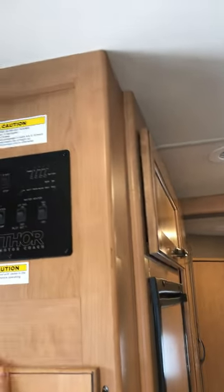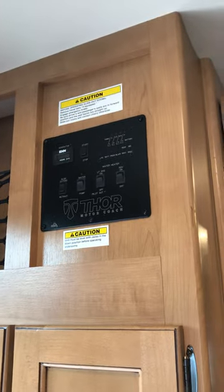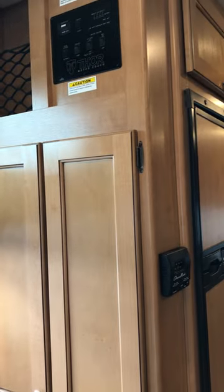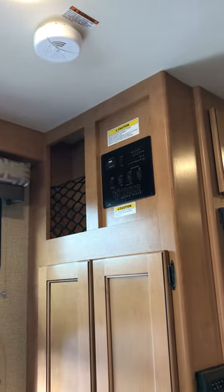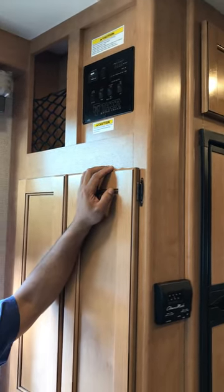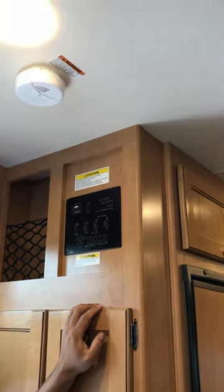Get down to the kind of important stuff right now. Generator. I'm going to go unplug us real quick. So far, so good. Generally, you don't want to turn your generator on when you're plugged into shore power. Your transfer switch will keep jumping, and it'll ruin the transfer switch. We had the same thing on the boat. People don't run the generator enough. The guy says, just turn it on, it doesn't use hardly any gas. When you came back, you had all the different switches. Of course, the panels were a lot more complicated than that.